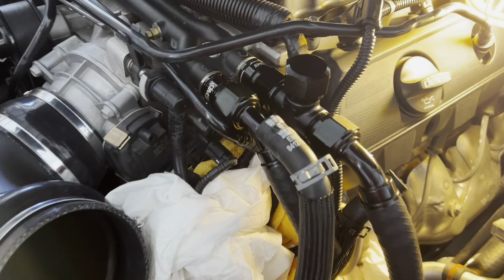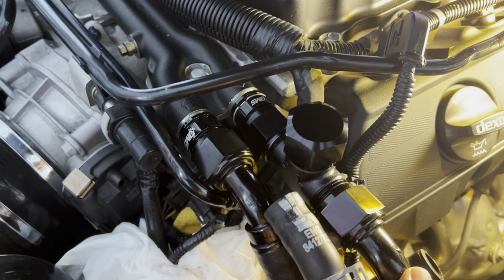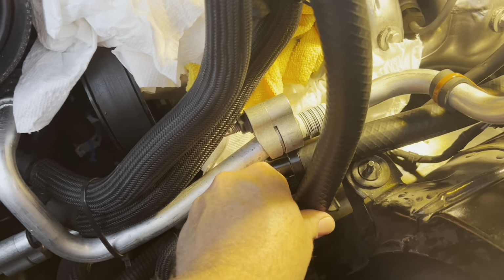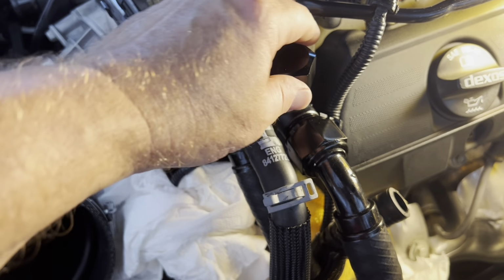All right, so now I've got my outlet hose from the supercharger out to the tank completed. That's a done deal. It routes right underneath the cold air intake and just clears right here with no issues. I installed a T on mine here just so I could get a little bit more air that may be trapped in the top up here.